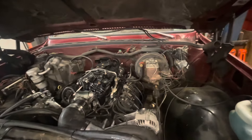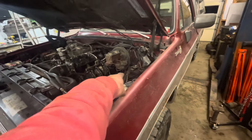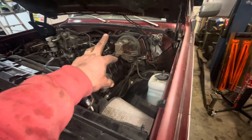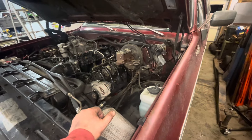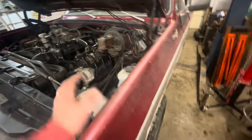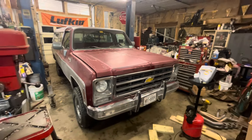I'm going to top it off and get it the heck out of here. Now I know for sure the mechanicals: it's a 6 liter LS, transmission is a 4L80 overdrive 4-speed, and the transfer case is an NP205 cast iron case — a 1-ton case. I'm not sure why they did that when they built it, but it had to be something to do with mating to that 4L80, which is typically a 3/4 or 1-ton transmission. The front and rear end are still half-ton pieces, so I don't think they did it because they were afraid of tearing up a half-ton.